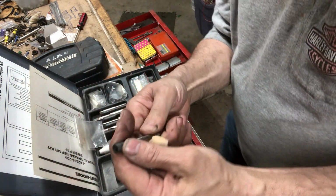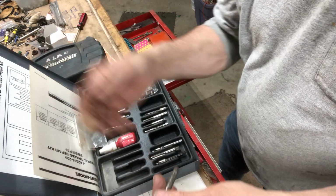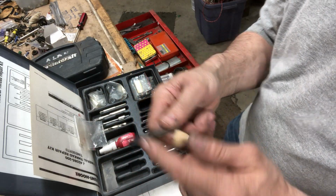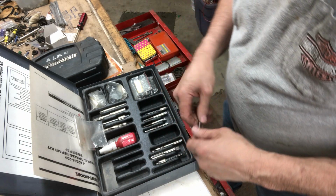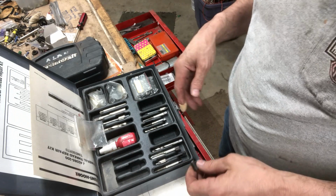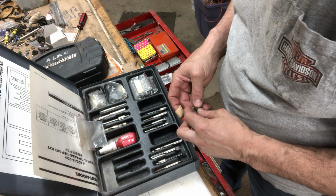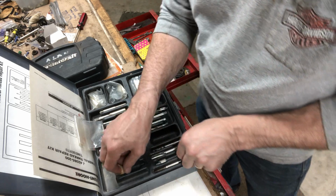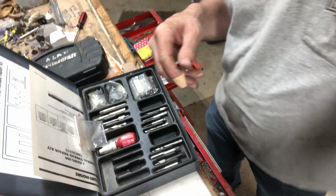With a helicoil, I don't know what you can torque it to, 30, 40 pounds, something like this. With this insert, you probably torque it to 70, 80 pounds, like double. Way stronger, especially in aluminum. For aluminum. Okay, so the only thing is, though, that we have the same issue.